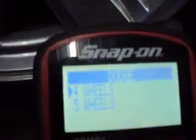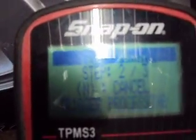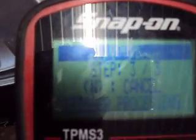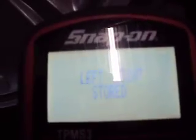I think we're all set up here for a Dodge. We'll press initial sensor test — Dodge, four wheels. This will probably take a second or two. It goes through all three steps here to find the first sensor. The first sensor always takes a little longer, but once it learns the proper frequency, the second sensor will go faster.